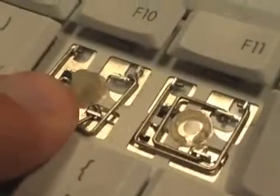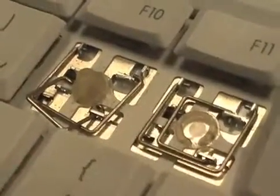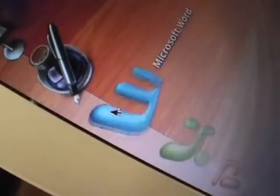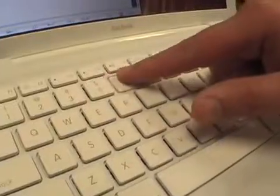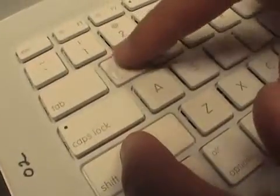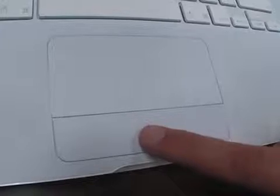You have to be able to type, so on to the keys. Check for no missing keys — is the key replaceable and is the rubber spring still intact? No loose keys — can they be reseated? Keys should be operational with all keys typing properly. Open Word and run fingers down each row of keys, then hold down the shift key and repeat the process to check for sticking keys. Also check the trackpad button — does it function smoothly?